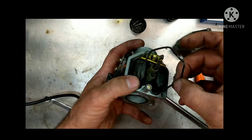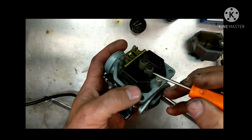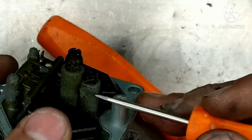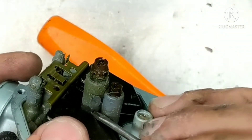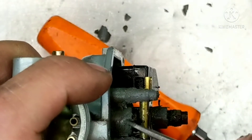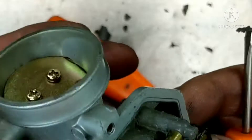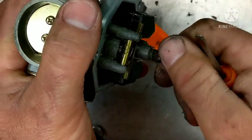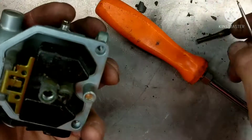Now let me show you something inside these carburetors — this is what the difference is. You can buy these carburetors if they're available for this particular model, but it's not — it's no longer available. These are parts of the carburetor. It's all pieces of built-up fuel and paint coming off of the carbs, so we've got to clean these up really good. Let's get all these jets out of here. That's why you've got to pull the emulsion tube out — it's green and nasty. Look at those holes, all those holes are clogged. It's never going to run like that.